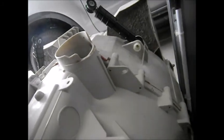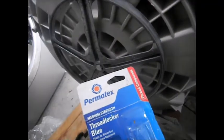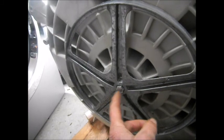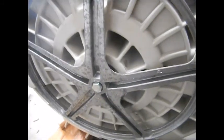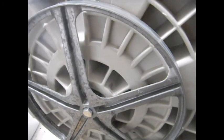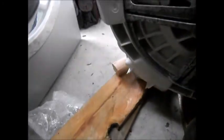I left the shocks on because it was kind of difficult to take out when it was sitting in there. I may take the shocks off because they can break fairly easily. As far as putting the pulley back on, I used the blue thread locker on it. I actually used part of the old stud that I drilled out — there was a part of it left — so I used that as a washer and tightened it down. I tighten it down almost as hard as I can get it, but not quite. If this comes loose, it's not like it's going to cause any major problems — it would get noisy first. There should be a torque requirement on this, but I just tighten it down pretty much as tight as I can with the blue thread locker on it.